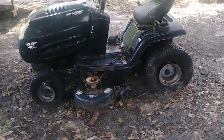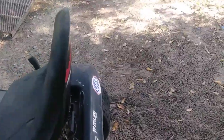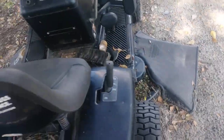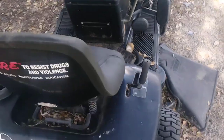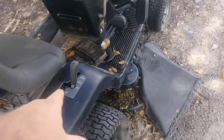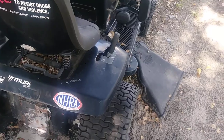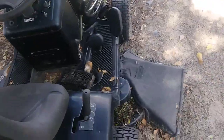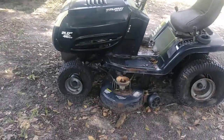I'll leave all the pulley setup I need under it because it's hydrostatic — it's a lot simpler. It's forward and reverse, that's it. Basically two pedals — forward, reverse — all I've got to do. I don't need all the tensioner pulleys and crazy stuff underneath like a regular mower where you push the clutch in to release the belt. This is more simple, a little bit easier.